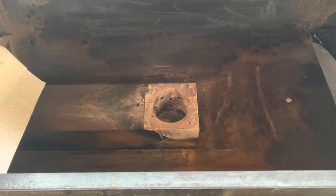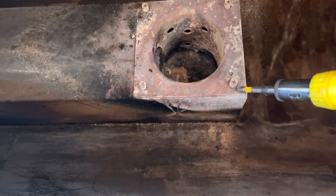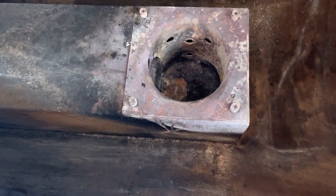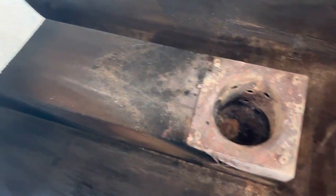We've got the diffuser out now, so we're just going to go ahead and take these four screws out. Once we do that, the pot will turn and lift out of there, and we'll be able to disconnect everything and run the wiring back out. While we're doing that, we've got our heat sensing probe on this side coated with some Easy Off oven cleaner, and the same thing up here. By the time we're done working on this, it'll all just wipe off. We had to take this little cover off with a couple of screws.